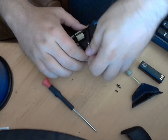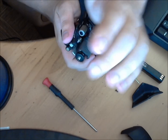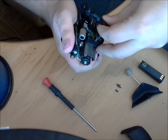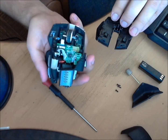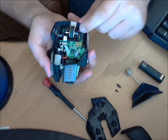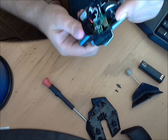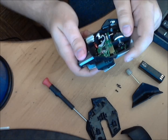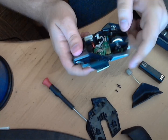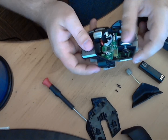Now that's done. It's really easy to pick up the whole back side. What you want to do is gently push it toward the rear while it's lifted up, because there are two retainers in front of it. And that's basically your mouse disassembled. There was a lot of dust and hairs right around this sensor here, which is for the scroll wheel next to the right mouse button. To clean it, just hold it like this, blow into it, and at the same time scroll a little while you're blowing — be sure not to use any saliva or you'll damage it. That gets all the junk out of the sensor real quick and easy.